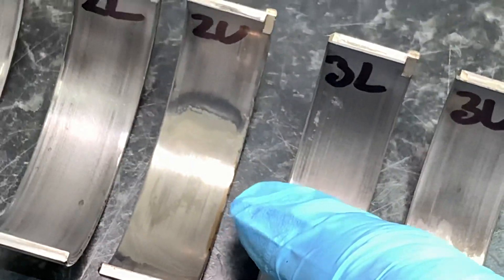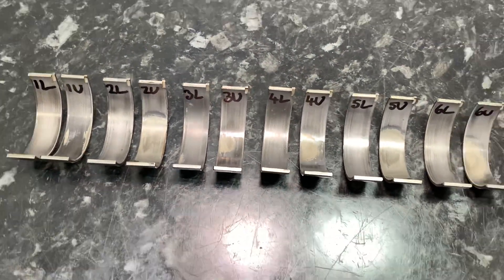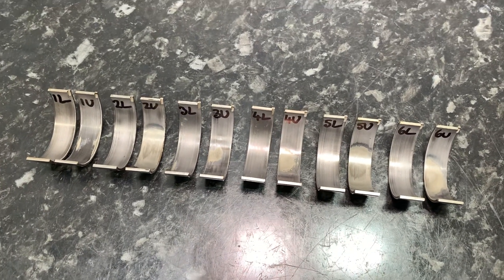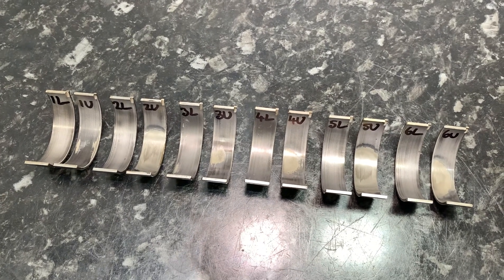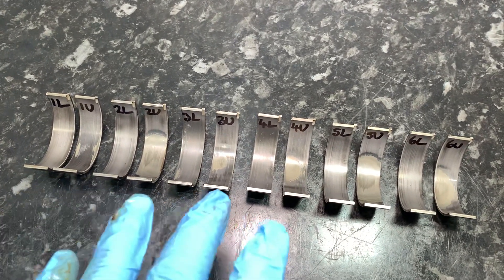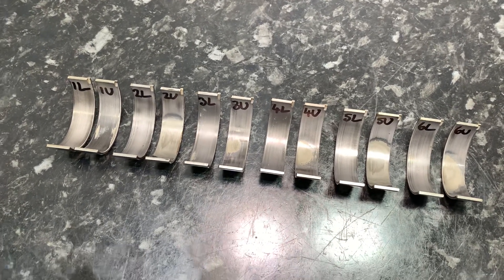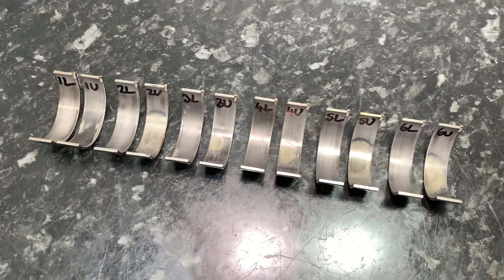When you wear through the lead you start exposing copper, which is just starting to show on the inboard edge of one and on the outboard edge of another — there's a longer stripe of copper on two upper. Copper is the last sacrificial layer before the bearing starts delaminating and breaking up. You were miles away from that stage, and you almost don't want it to get that far, because that's when it starts putting excessive metallic particles into the oil stream, through the vanos, pumps, and everything. You want some wear to quantify your reason for doing the bearings, but not excessive wear that damages the crank. It's a good outcome.